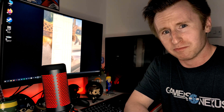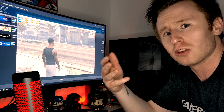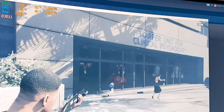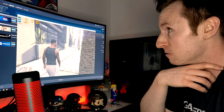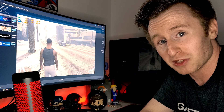The next thing we need to do is get a game loaded up and see how it handles being under a bit of load. I've been playing GTA 5 for about 20 to 30 minutes at 1920x1080. Running at that resolution is more taxing on the CPU compared to the GPU, so it should push our CPU a little further. The highest we've been hitting so far is 63°C, and it's still boosting to around 4.1 GHz — which is really impressive. If you really wanted to run this in a gaming-only system, you definitely could. I'm really impressed with this one so far.